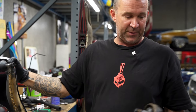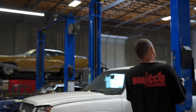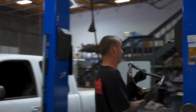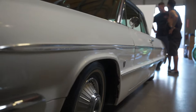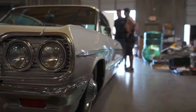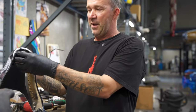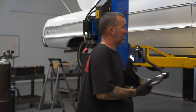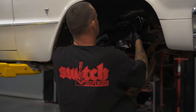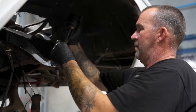This is an extended reinforced arm — you can see it's thicker than factory. You want to run this instead of stock because it gives more strength so it won't buckle. This car is going to be strictly a lay-and-play, not really hopping, but this extension gives you the ability to lift further without slapping the frame. It also gives it that cool wheel lean and allows the wheel to run more straight up and down when you're at the taller lifting points.